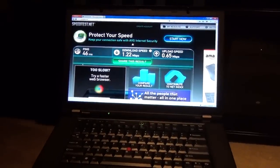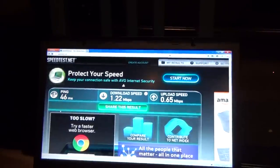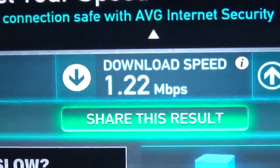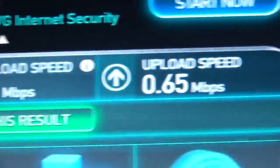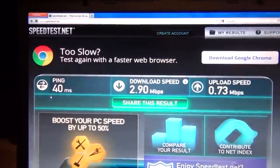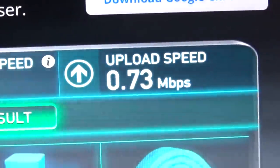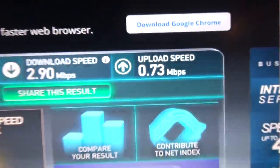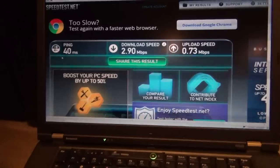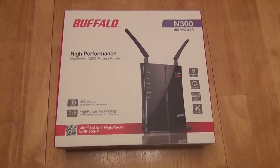Now for one more comparison of the old router versus the new router on my laptop in an upstairs bedroom away from the router. On the old router we get 1.22 megabits download from the bedroom upstairs and 0.65 megabits upload. And now with the new router on the same laptop in the upstairs bedroom, we get 2.9 megabits download and 0.73 megabits upload, very close to the wired speeds. And by the way, the signal strength of both routers was pretty decent in the upstairs bedroom, but the throughput didn't match up. Thanks for watching the review.